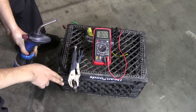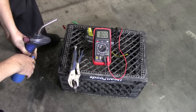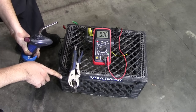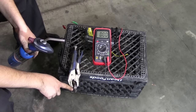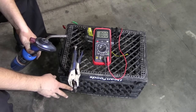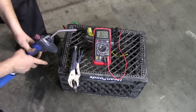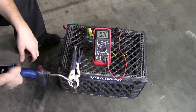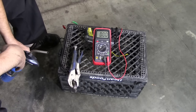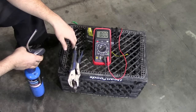Next it's time to see whether this oxygen sensor can produce voltage or not. Since sensors don't produce any voltage unless they reach 600 degrees, we're going to be using our propane torch to heat it up. The flame over the sensor is going to take away all the oxygen, and the less oxygen the sensor senses, the higher the voltage reading we're going to get. We're looking to get close to one volt when we heat it up properly, and when we remove the torch we're looking for the reading to shoot down very quickly to close to zero.